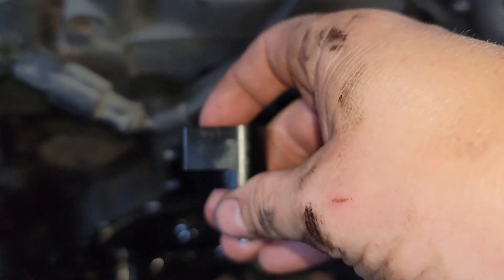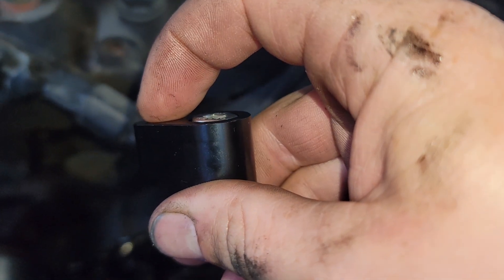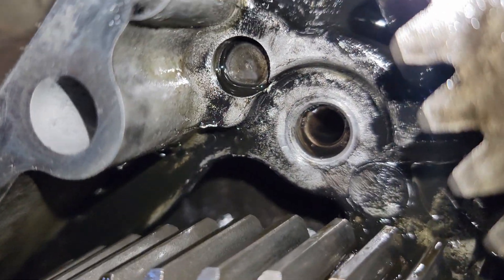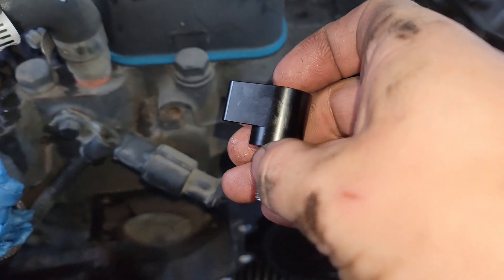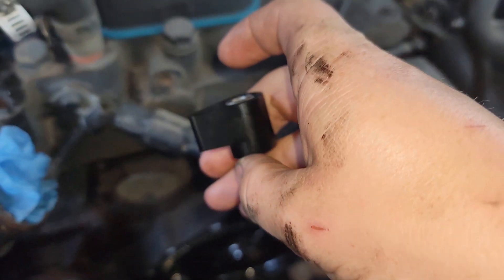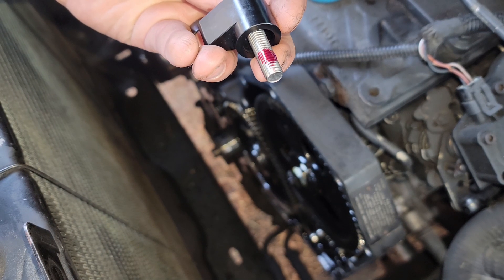This kit from Amazon is designed pretty cool. There are two different timing cover designs — one has a step in it like this one. You can flip this bolt around and use it both ways: flat from the bolt hole to the killer dowel pin hole, or with a step. In this case I'm going to use it with the ridge where the bolt is and where the KDP comes up. It's also thick enough that if the bolt ever backs out it'll hit the timing cover before falling between the gears — so it's designed in a way that if it ever backs out it won't cause damage. I'm going to place a drop of red thread lock on the new KDP.